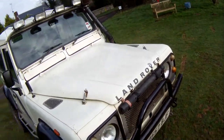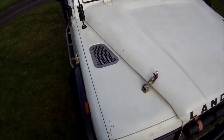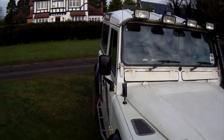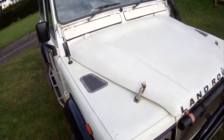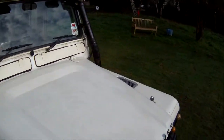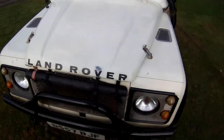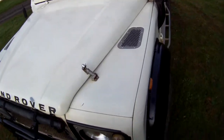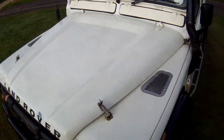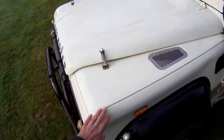We'll go round it and pick out what we can to criticise. Because it's 1987, it's quite an old girl now, the paint has suffered a bit — especially being white, which tends to get a bit marked and untidy over the years. There are a few bits of paint loss and electrolytic reaction up here, it's obviously had a sticker along there at some point, paint loss down to the undercoat on the front of the bonnet, the nearside headlamp cover has a break in it, and there are some hedge scratches down the nearside front wing.